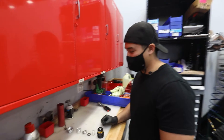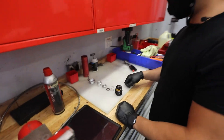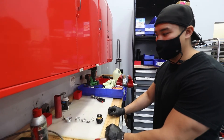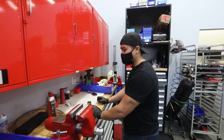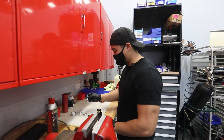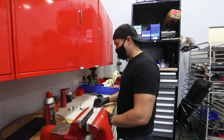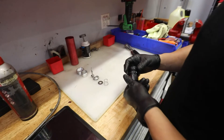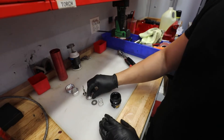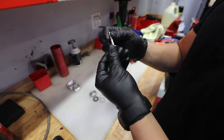Now we're going to begin the reassembly of the canister. I usually start by reassembling the canister first, then I'll attach the hose, put it to the body, and bleed it. Then I'll get the piston rod set up and bleed that. Pretty much you're done after that - you just got to throw the dust cover on and the guide. I laid these parts out so you can see the order it goes in for the head of the canister. I've already replaced these O-rings to save some time. There's an O-ring on top of the canister, one right here, and a small O-ring on the compression stem.